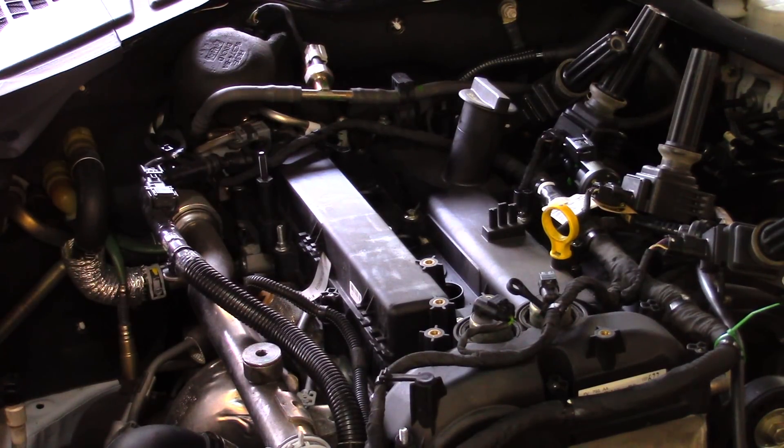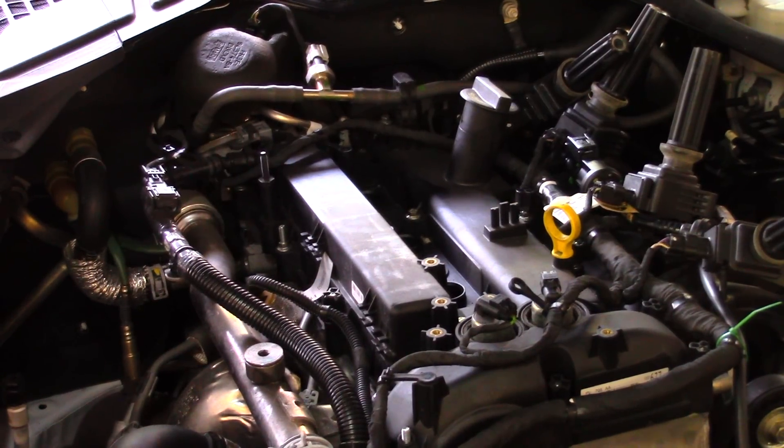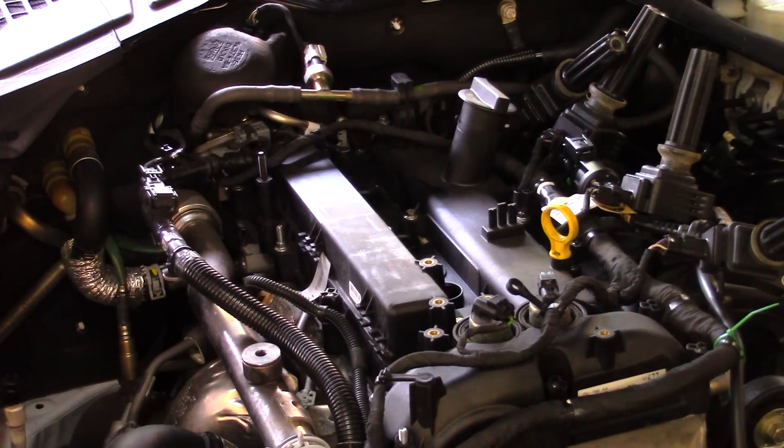So now what we're going to do is install these guys back into the car and then we're done. Reinstallation of the spark plugs is the opposite of removal. We're going to drop the plugs in and tighten them down. There's a lot of controversy on how tight these should be — a lot of people say hand tight and a quarter turn, but hand tight and a quarter turn to you is different than to me. So I'm putting them in at 18 foot-pounds; we got our torque wrench here to measure that out. Some people do 12 — what you choose to do is up to you based on the research you do. I'm doing 18 and so far I haven't had any problems with that, so let's go ahead and put these guys in.